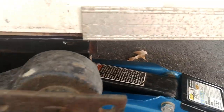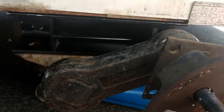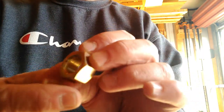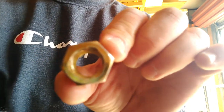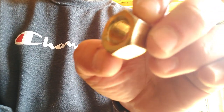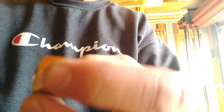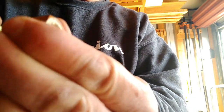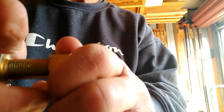What I'm going to do now is install the bolts and nuts. It's kind of tough to see, but you can see how this bolt on the inside has these little indentations where it's been serrated. What you're going to do is start from the opposite side, so that when you screw this in, the bolt goes in fairly easy and then gets to a point where it becomes very difficult — and that basically locks it down into place. For this one, this is going to go through the back side, so we'll put this in first, and there will be a washer on this side for the back.